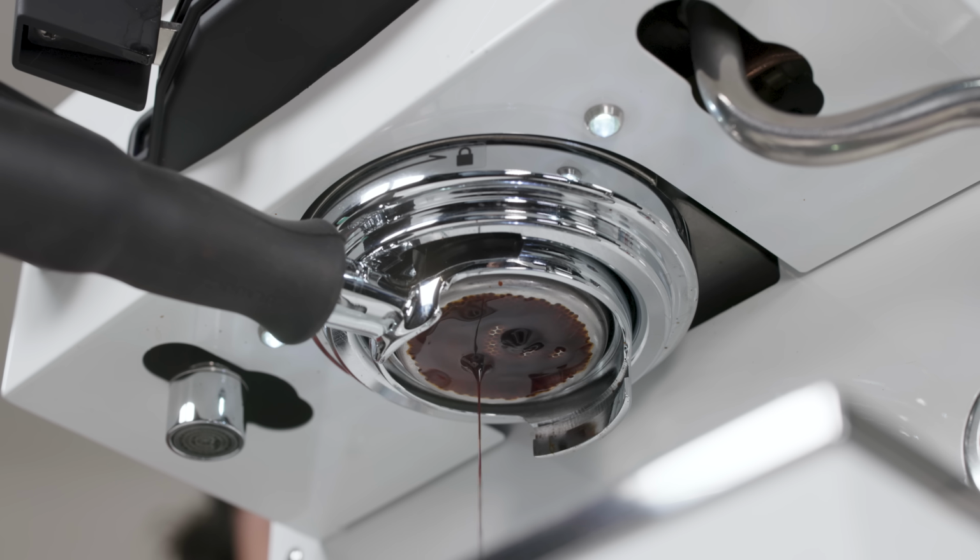Now, if you had a 3-second pre-brew, yeah, it won't reach the desired static pressure. But what we just did definitely reached right at that 9 bar. I only did 6 seconds. If I did a full 9, it 100% would have reached 9. We probably reached 7 or 8. I don't have a Bluetooth transducer in there to really know.